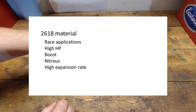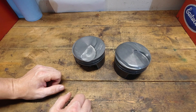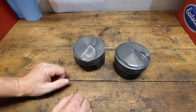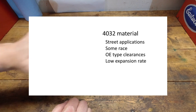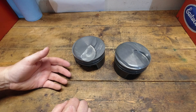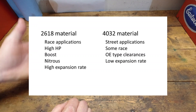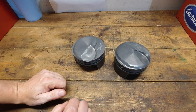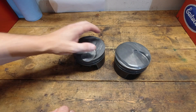In my case, because of the Chevelle, I'm okay with a little bit of that cold piston slap and the noisiness of the 2618 forged material — it's going to see a little bit more abuse and I'm completely okay with that. Could I have run a 4032 in that big block? Absolutely, no problem — it's still a very good street piston. I'm not looking at making 800 or 900 horsepower; it's going to be a 750 horsepower engine. The 4032 could have been a good choice as well, but I went with the 2618 because I know what I'm going to do with it and it may get a squeeze of nitrous here or there too.